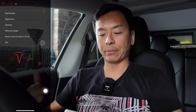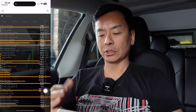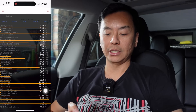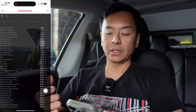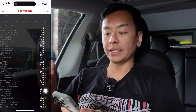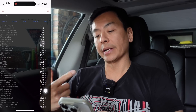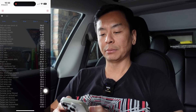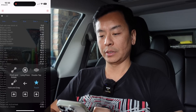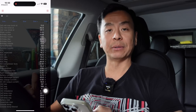There's another cool aspect of this app, which is the signal list. You can look at all the different signals and filter them — just battery, just temperature, speed, HVAC. The CAN bus spits out these signals, and smart people who developed this app decode it for end users. You've got things like birthday year — that's pretty cool. Birthday year: 2019. Birthday month: July. Birthday day, down to the very day it was built. Birthday hour and minutes: 2331.